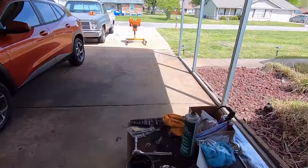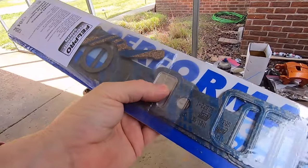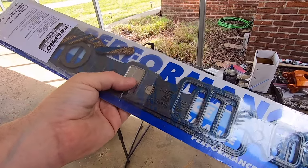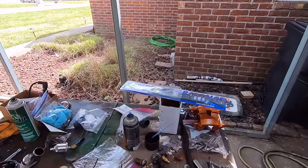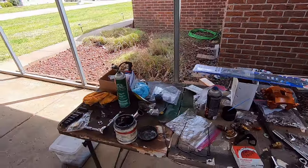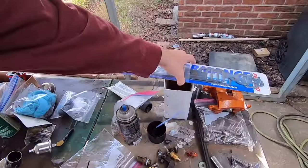He brought the Felpro 1204 for a small block Chevy. It has exhaust crossover stainless steel block-off plates that are spot-welded together. This keeps the exhaust from coming out of the head and going underneath the carburetor to heat up the carb pad, which is not good with ethanol-blend fuel — it can cause vapor lock especially in the summertime. I usually use this style gasket with a phenolic carb spacer, a thin one, and I don't have vapor lock issues anymore even running cheap 10% ethanol fuel.